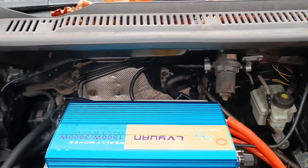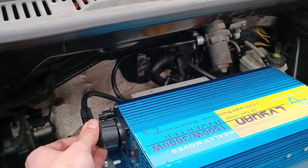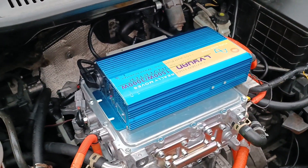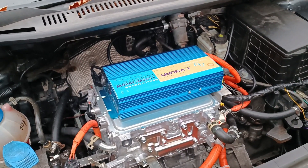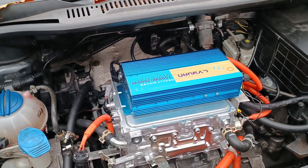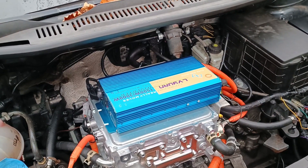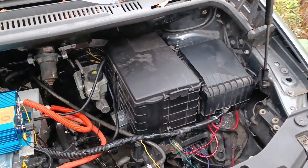As a bonus, I can unplug it from here and plug it into a regular wall outlet to pre-heat the car without drawing energy from the battery. I can also plug in anything here, so wherever the car is parked it can supply up to 3 kilowatts to whatever you want to run. I ran this year's summer festivity in August from the car alone — we used about 30 percent of the battery instead of the roughly 10 liters of diesel we used to burn for that event.